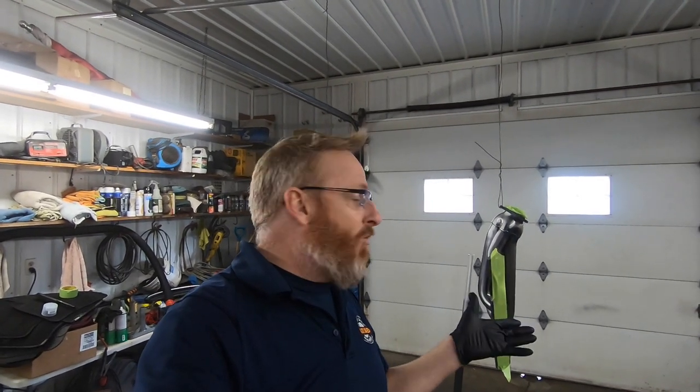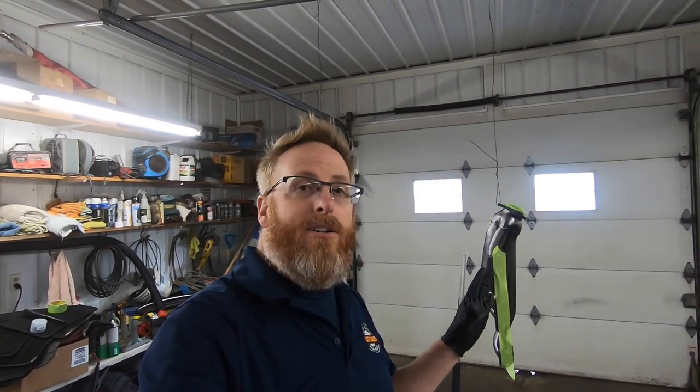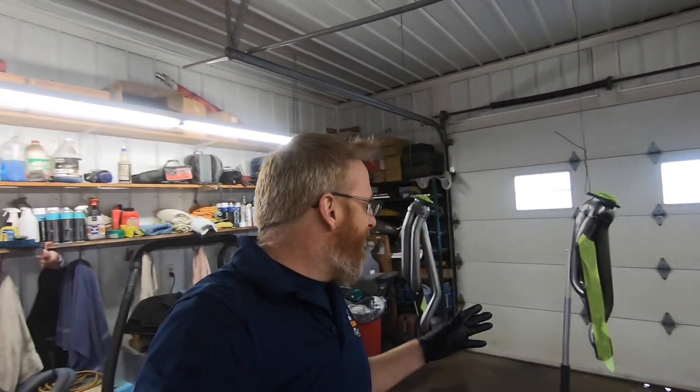Hopefully the clear coat does not react that way. Once we get them installed, we're gonna come back and do at least one more coat, maybe a third, and then the next time you see them they'll actually be getting installed on my small block Chevy in Dale the truck — my '77 Chevy C10. That's it — just a quick video on what I believe is the proper way to clear coat headers. If you guys want some of this VHT clear coat high heat header paint, I'll leave a link in the description box below for my Amazon affiliate.